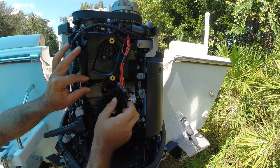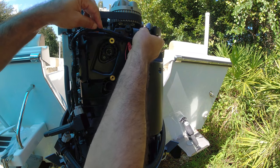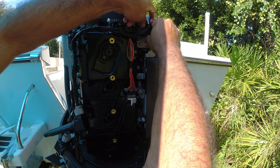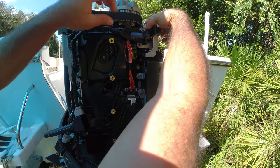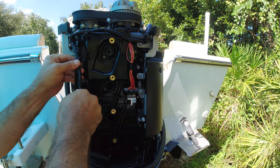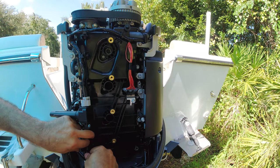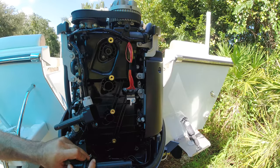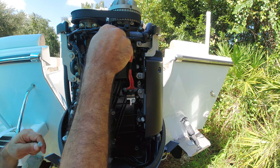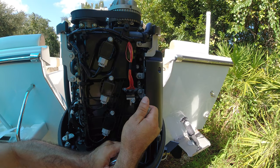After tightening the bolts correctly on the crankcase, now I'm going to connect the wire harness — just push it down, there it is. Connect these hoses back here — this hose just goes in placed in, you don't have to secure it, just push it all the way in. Securing these little clips up here all the way to the bottom. And now the spark plug connectors. Put all the bolts back — all snugged in.